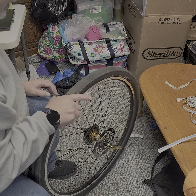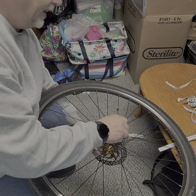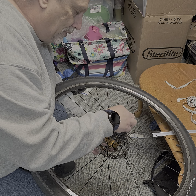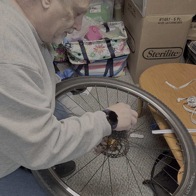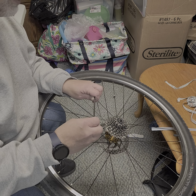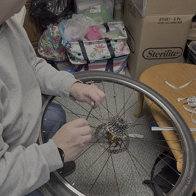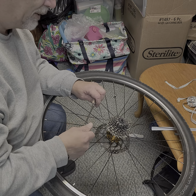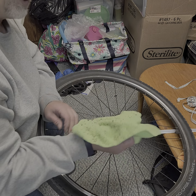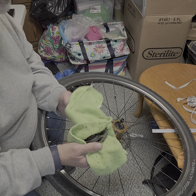So this is the new wheel. I'm going to show you. It has a somewhat of a parlor trick right here. To get the cassette off that one, and this one for the most part, you have to pull. So we'll pull this skewer, put the spring back on, simple steel skewer, and I don't really want to get my fingers dirty, but put that over there for now, and we'll pull. Watch. There we go. You need to clean your cassette body.